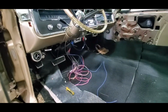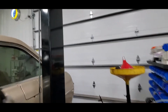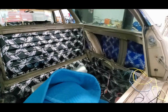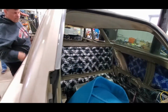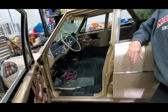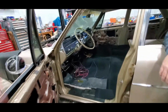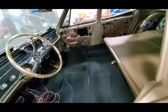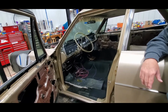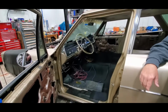None of this has really changed this week. It's Thanksgiving week in America. So from last video, you recall, Diesel was down in the well, working over here, getting all this done. And one of the things that we're getting closer and closer to doing is burning in the carpet, which is how we're going to do all the bolt holes. It's a lot easier than trying to cut it with a knife and hoping it doesn't fray. We just take a portable soldering iron, get it really hot, and poke it through. Or you can take your torch and heat up a screwdriver, whatever it is.